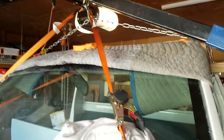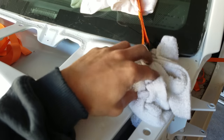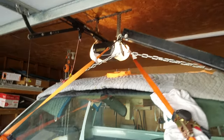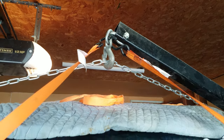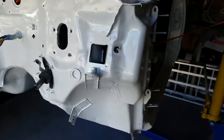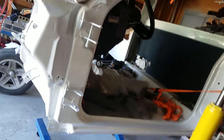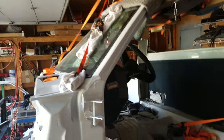What I did was I took two ratchet straps and there's this opening here. I took this towel, wrapped it around there — that's supposed to be protecting the metal from the glass — and then just ran it right above the hook on one of the chain links. What that did was it lifted this whole front end, because if you just do it with the hoist, that front end is going to tip on you. So you lift up the front and it makes it even.